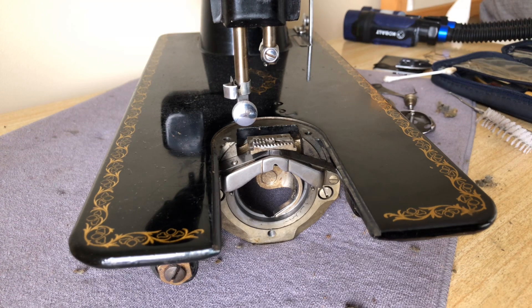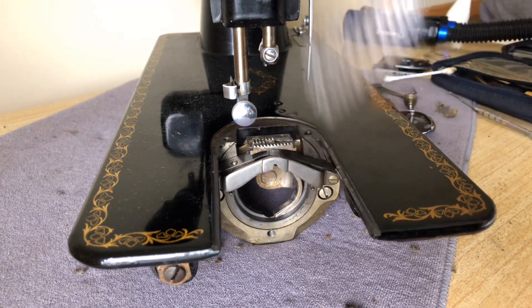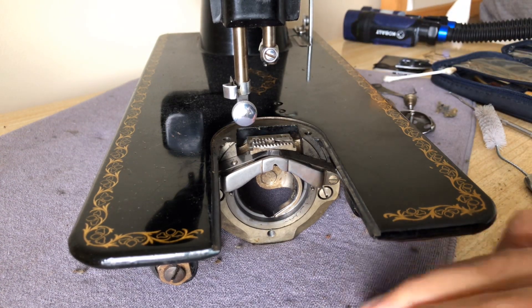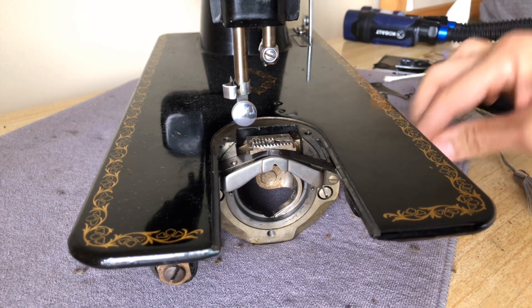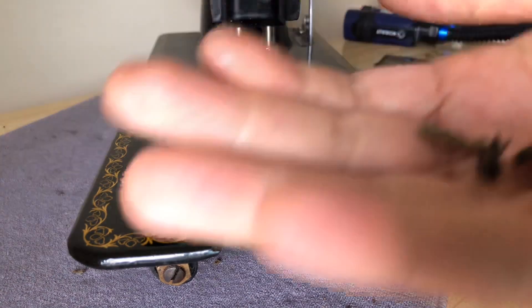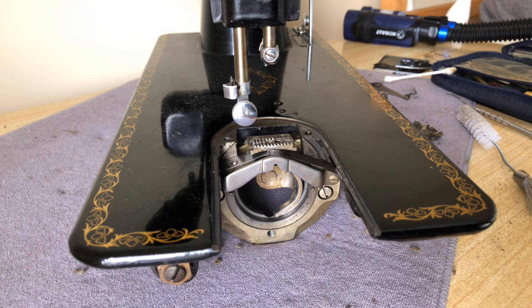I thought I would show that to you — I was thinking about videos I haven't done yet, and with the machine here I'm happy to do them. Most of you, when you're cleaning your lint regularly, it's not a big deal and doesn't take long. But if a machine has gone a long time without lint cleaning, you can end up with a giant clump, and it adds friction — it makes the machine have to work harder to do its job, and there's no need for that. Be good to your machine and it'll be good to you. Thanks for watching — if you have questions about feed dog cleaning, put your comments below and we'll see you in the next video.